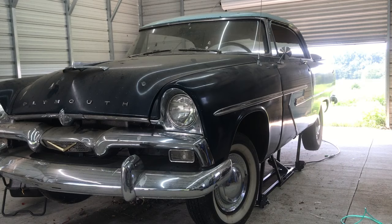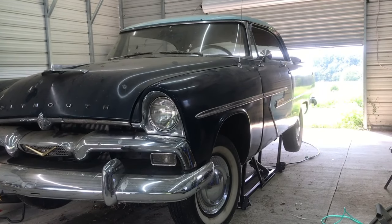Anyway, there are some patch panels available that I've found. They are old patch panels, and they come with their own rusty patina at no extra charge. But I'm not so interested in the exact panel as I am in having the proper gauge sheet metal, especially if it's got some of the proper curve. Fortunately, until you get up on the tail fins, there's not a lot of reverse curves here. You've got your flare around your front fender, and a little bit around the back.